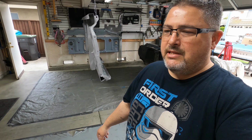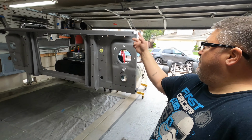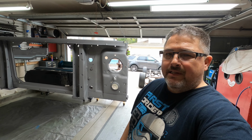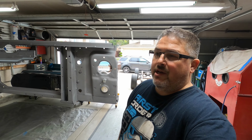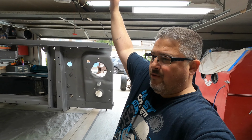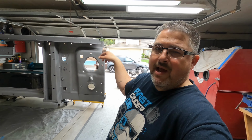I've got both these pieces suspended with baling wire. You take this baling wire and you put it inside your drill and you twist two pieces together. This sounds pretty rigid. It's great for hanging parts and stuff like that. You just paint over them. When I'm done, I just kind of fold them up out of the way. When I need them, drop them down, hang something and paint it.